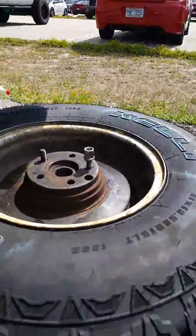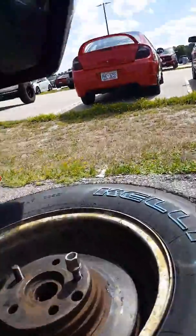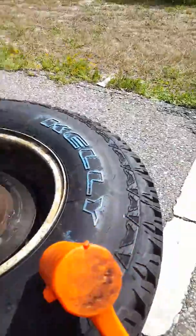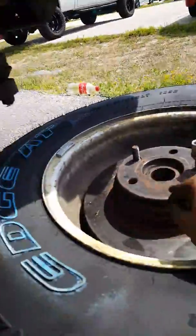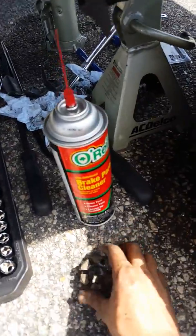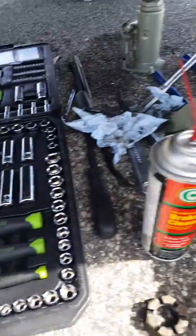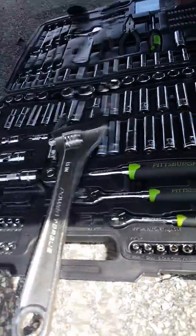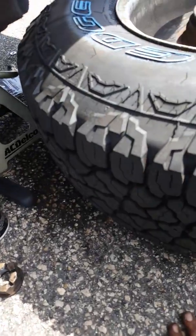Basically this is what I have to do in order to get this thing out. It's kind of a tutorial as well, because in order for me to get these rotors out, I had to pull the cotter pin and castle nut out. And that was a fun thing to get rid of, especially with just a wrench and some breaker bars. I don't have a socket that's big enough in this set, and I didn't really expect it to be this dang hard.